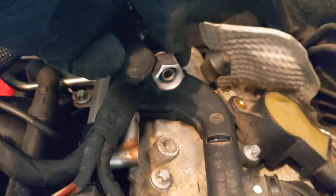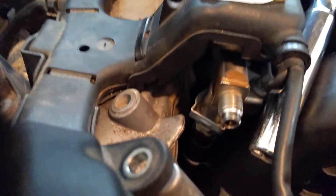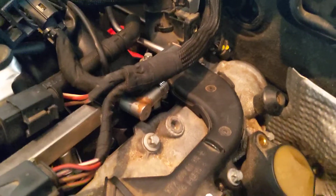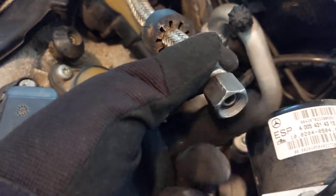The hard fuel line is going to screw into this fitting right here. When you take that off it will leak a fair amount — there's still going to be fuel in the lines and it will be pressurized. To stop it from being pressurized, you're going to take something small and preferably plastic, head right underneath this little cover here, and insert it in there. It will relieve the majority of the pressure so you're not going to have 50 psi or whatever it is spraying fuel out of this end. However, it will leak out of both sides. I waited a good while until after the car had cooled off, because fire is in the equation whenever you have a hot car — it's the middle of summer and fuel dripping down into the engine is a concern. I believe it's a 17mm open face you can just twist this guy off with. It is sleeved on there so it's not going to fall anywhere, but when you get it loose it's going to leak both ends.